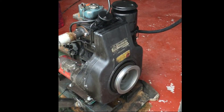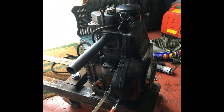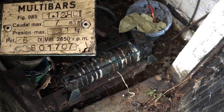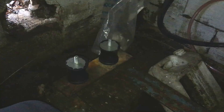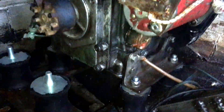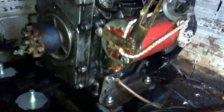Thanks to the help of a dear friend, we carried the engine to the house and tested it on the bench. This engine vibrates a lot due to the torque it generates, so some silent blocks were definitely a must. Here you can have a closer look at the water pump — it's a Delul multistage rated at 6 horsepower. The body is made of cast iron while the rotating parts are made of brass. The first thing I did was mount the engine and the water pump on these very large silent blocks.